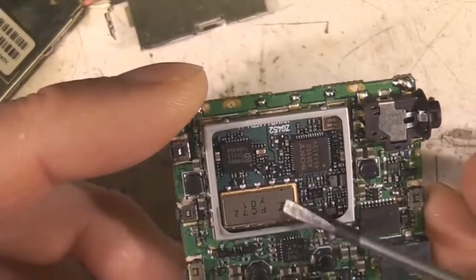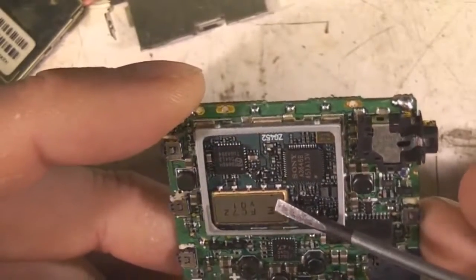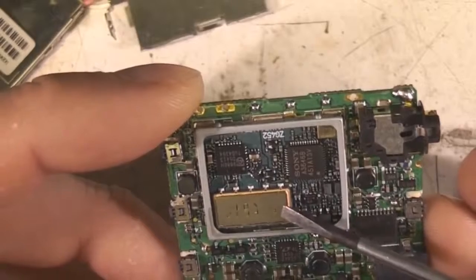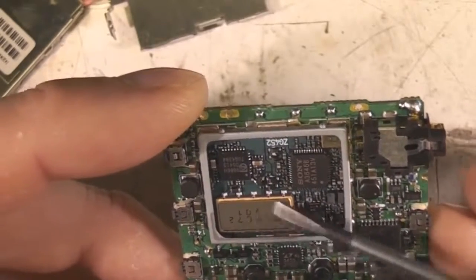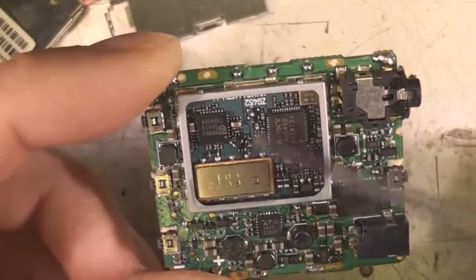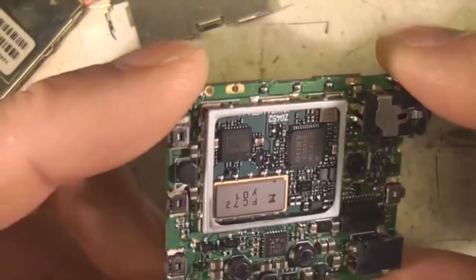This is going to be a surface acoustic wave filter. These are very commonly used in TV IF stages to provide a very precise filter characteristic. It's like a sort of acoustic device. It's got piezoelectric elements, and by the shape and machining of the piezoelectric element they can get very precise filter characteristics, but certainly all throughout the 90s onwards these were very, very commonly used in TVs.